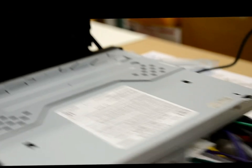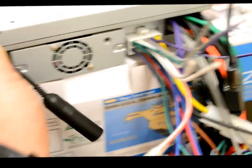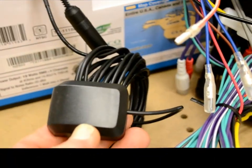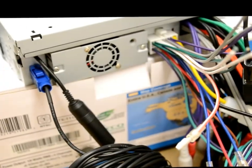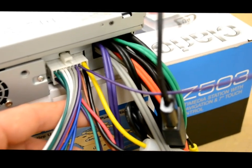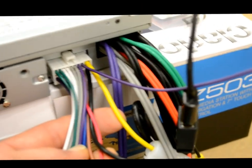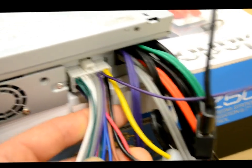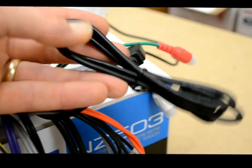Let me spin this around. Back here you can see the antenna — it's exactly the same as it was last year, nothing's changed. So if you're upgrading, you can simply unplug yours and plug this right in. Over here is the standard 16-pin harness. This one has 19 watts RMS by four channels. And over here is the USB pigtail — they give you about two feet or so, maybe a little bit more.